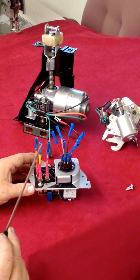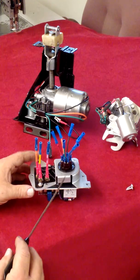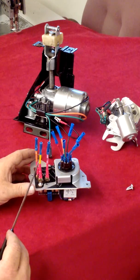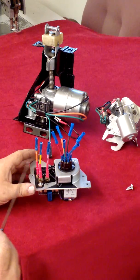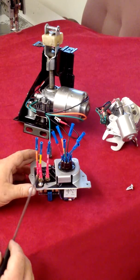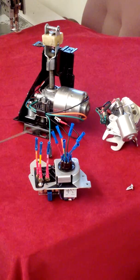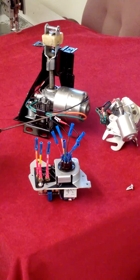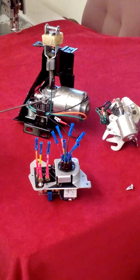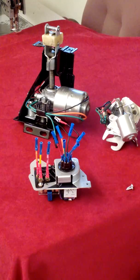Not a necessary part. The reason we've eliminated that, we found in the past when rebuilding these relays that this lead has failed. This lead has a small diode that comes off of it, the lead that we eliminated. And if that diode ever fails, it feeds power back through this relay system and burns up the relays. We accomplish opening and closing and notifications to the operator of the vehicle through this lead here on this component, which is a lot safer and doesn't cause any problems down the long run.